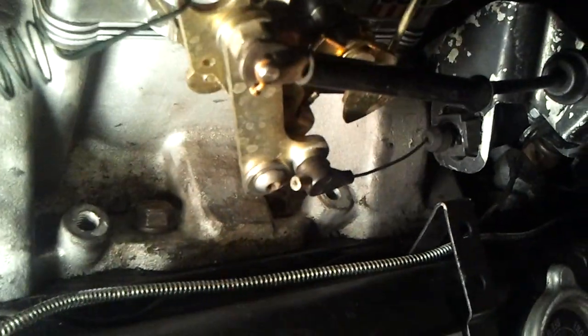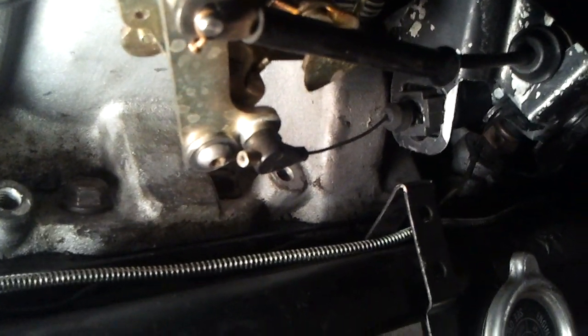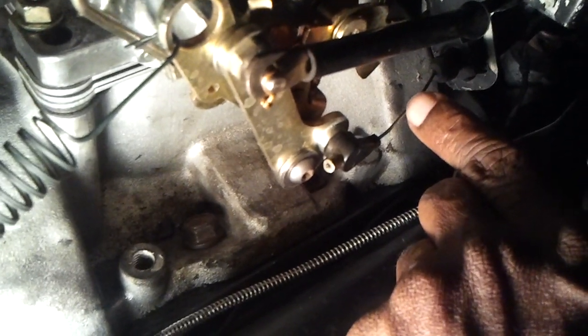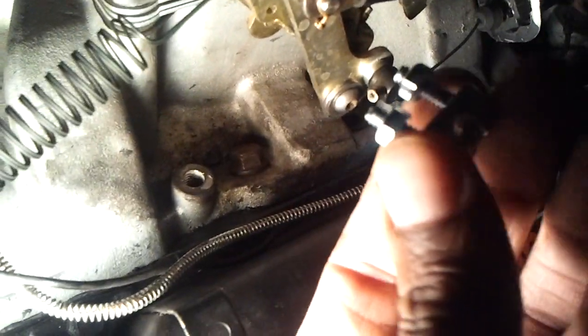They tend to pull out sometimes, you know what I mean. See how when you pull it, it stays in place? Let me show you that again. Some of us have 700R4 transmissions, and some of us don't have the money to spend on the more expensive ones. See, when you go to pull it, sometimes this thing will pull way out here — but when you hook that clip up behind there, it'll hold, stay in place, and give you good line pressure so you can adjust accordingly.